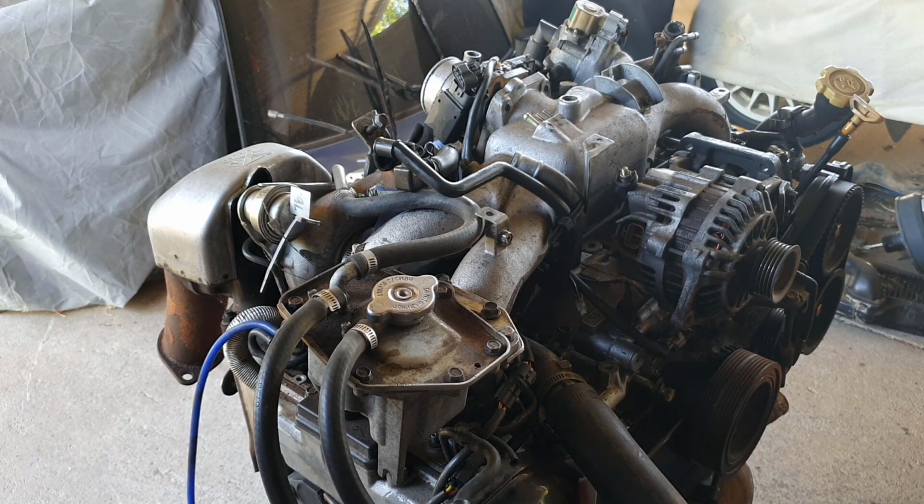Yeah, it's got all new pulleys in it, which I would have expected. I know the guys that rebuilt this engine, it wasn't done by us. But it looks pretty good. Just to make sure that nothing has transpired in there, the belt hasn't jumped any teeth or anything, but it's got a good belt in it. I can see all the timing marks have all been done in there.